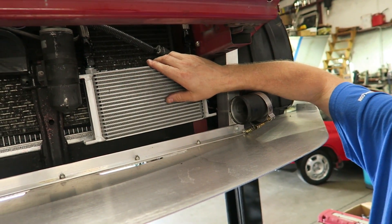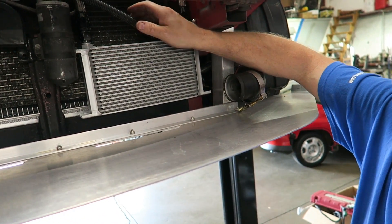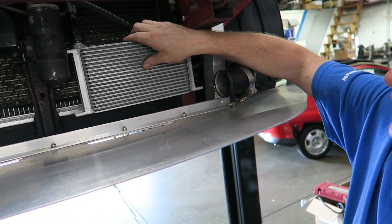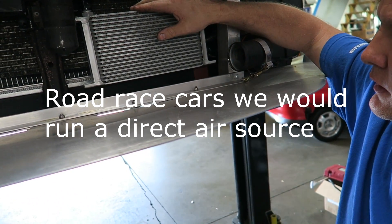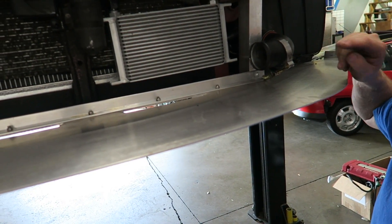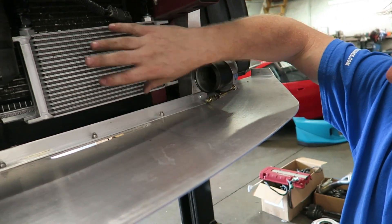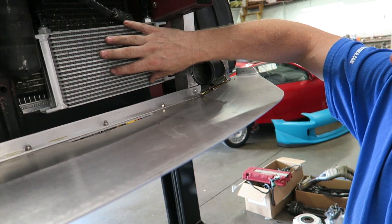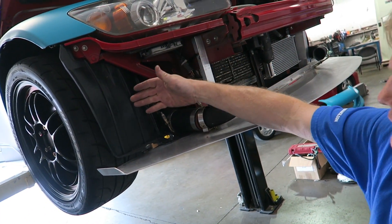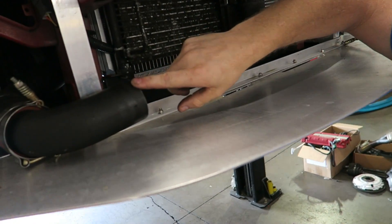Let's relocate this — this is the oil cooler. The radiator already has the condenser in front of it and the intercooler, which is big. This is just restricting airflow and doesn't need a direct air source for what this car is doing. We're going to be changing the fans — it's got some cheap eBay slimline fans that aren't strong enough. We're going to relocate the oil cooler over to this corner, which is the faster side of the car.